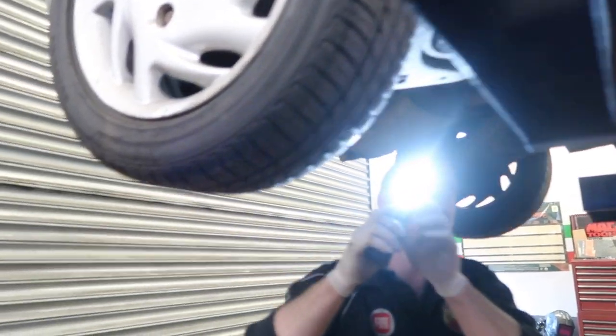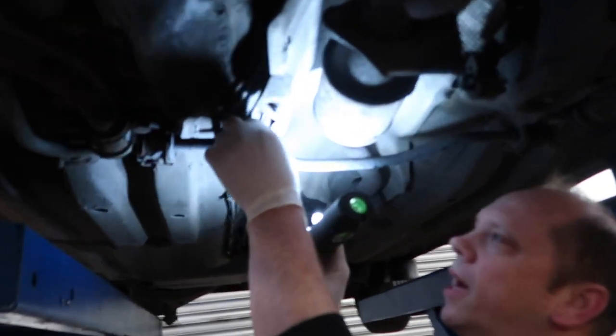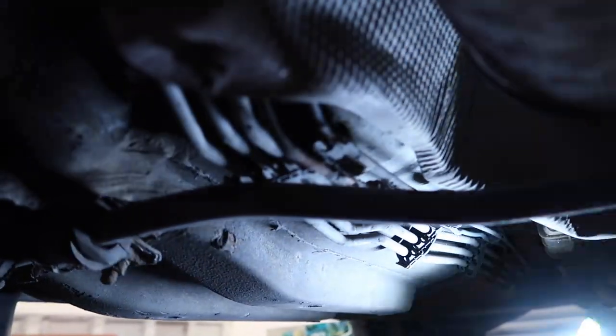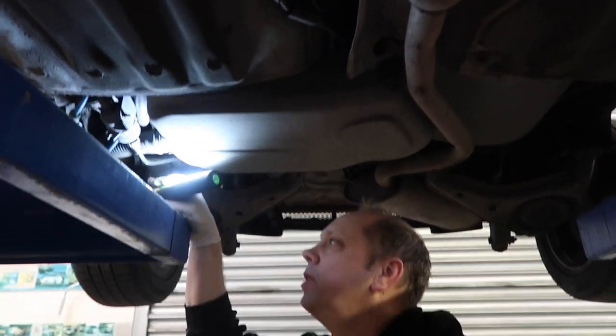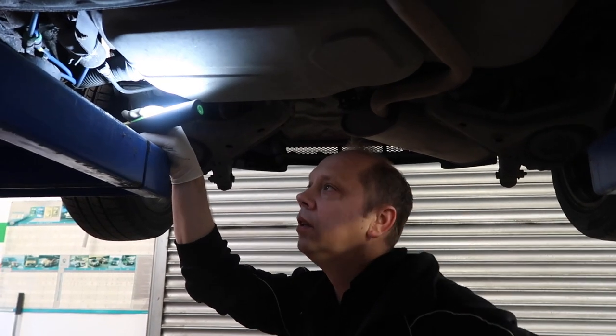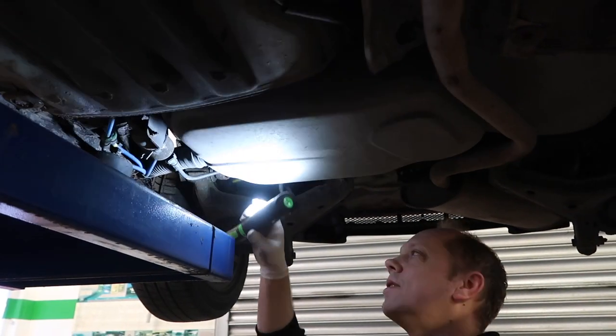More corrosion. You've got another brake pipe there — a lot of corrosion in it. It's already had one copper pipe up to that point. To be fair, that probably would clean up and treat. It's had a new tank, so that's a good thing. Are they quite prone to rusting through? Well yeah, there was a recall on them — probably from '99. Went on for the best part of 10 years. So I've changed hundreds of these fuel tanks.